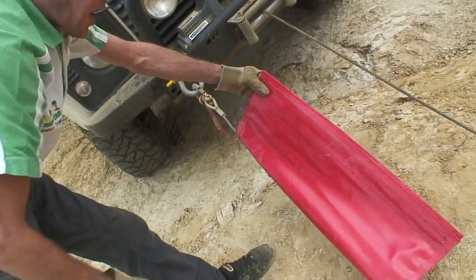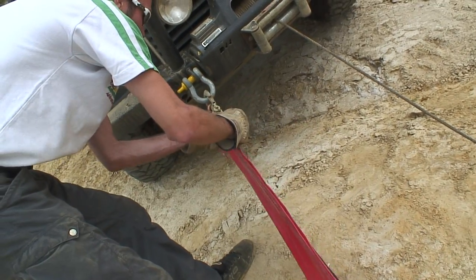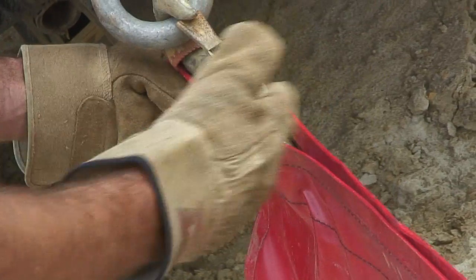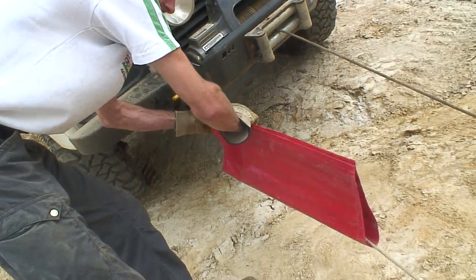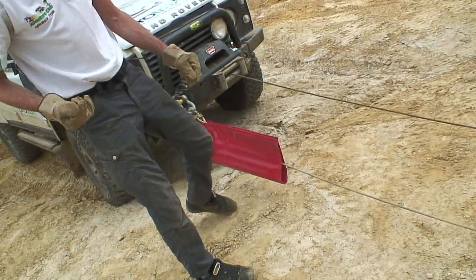Here we have the Rugged Guide Wade and Winch blanket. Many different blankets on the market, but again, this one stays on the front of your vehicle, and we can fit it around the hook end, which is the man-made end, and with the visual checks we've given this cable this morning, this is the only bit I can actually say that could fail. So I'm going to fasten that there. This should hopefully now bring the cable to the ground, stopping it from going airborne also.